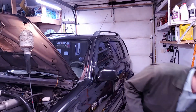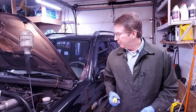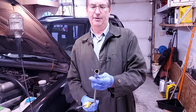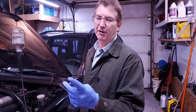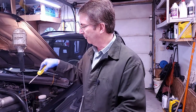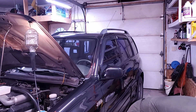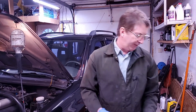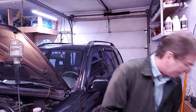We're going to get going. I'm going to need a Phillips screwdriver to take the cover off right here, a spark plug wrench — five-eighths. On this particular vehicle, make sure you get a spark plug wrench with the rubber inside, because those plugs are way down inside. And just a quarter-inch ratchet at five-eighths, and a regular pair of pliers.